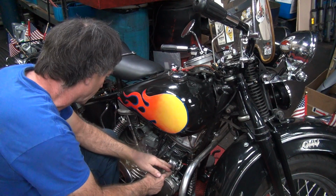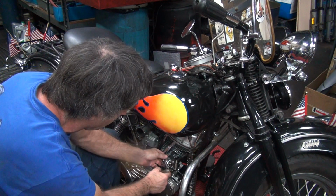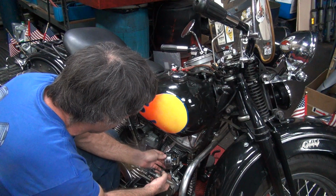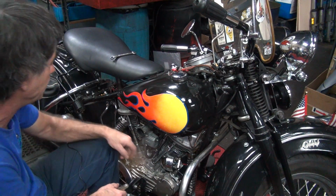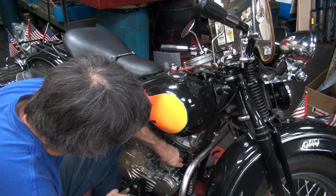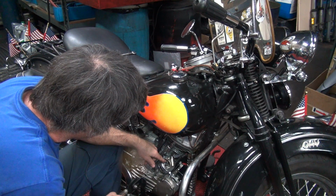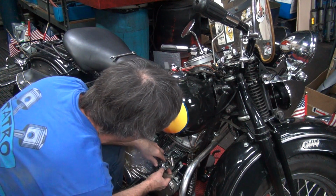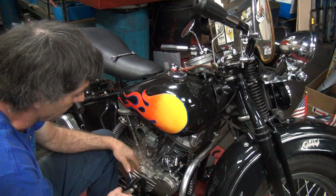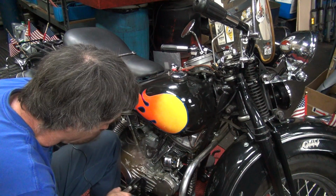If you short the ignition out, things won't work, but I don't know what the problem is. This is all grounded through here. What the fuck, man? I can't figure this one out at all. So we should have power through the coil, but we're not getting any. Now if the points are short, you won't get power either, but you should have power going down to it. Should have power going to the points at least. Assuming we don't have some insulation issues, which I can't tell because it's all hooked up right now. So we'll be grounding up to your handlebar wire because it's connected here.